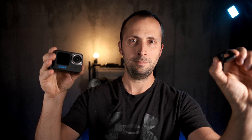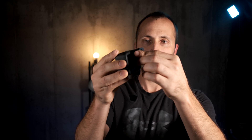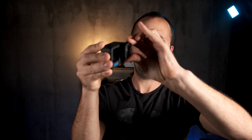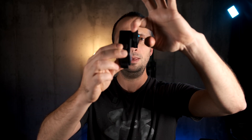Once the firmware is installed, you can connect the Max Lens Mod to your Hero 10 Black. If you're new to the Max Lens Mod, here's how to attach it. The stock lens is removable — pull out slightly on it and twist a quarter turn and it pulls right off. It's tricky the first time but easy after that. Next, get out your Max Lens Mod, line it up — there's a pattern on the back of the Max Lens Mod that corresponds to the pattern on the camera. Make sure those line up, then twist it a quarter turn until it's fully attached. Make sure there's no gap between the lens cover and the camera.